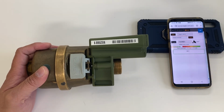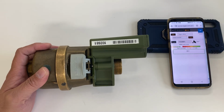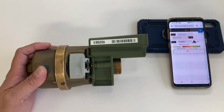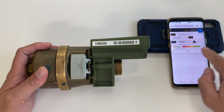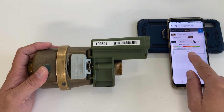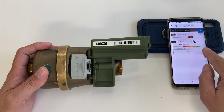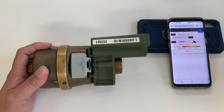As I've said earlier, or in my previous videos, the recommendation of Taggle is to use a tag when the reception we get is from negative 130 and below, which means negative 130 to probably negative 60 or negative 50 if you can find that. Or if you want to use the color code on these bars, it should be around the orangey thing, from green to the orange. If it's just red, it's not good.